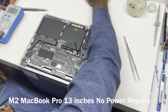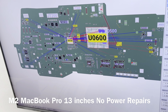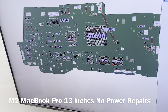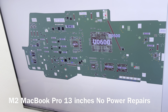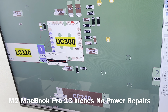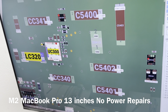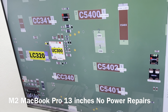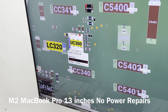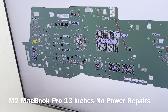I was talking about the common points to check if it was an M1, but this is not an M1 board — this is an M2 board. If this was an M1, a common failure to look out for is a short on the 3.0-volt line and the 5.9, which is also common. When that fails, you might have a problem with the device starting. However, if that rail is not present but not shorted, the device will power on but you will not have backlight on the screen.